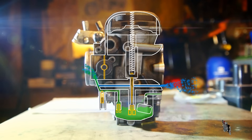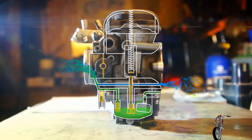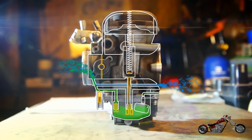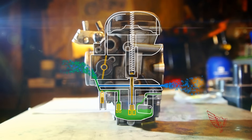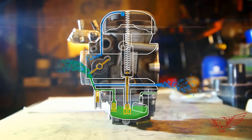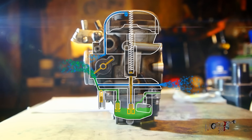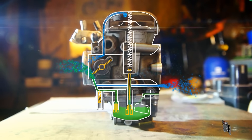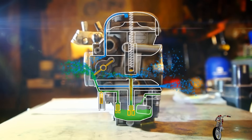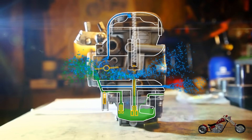Now how does it work? In idle condition the fuel is sucked out of the fuel bowl through the pilot jet and is mixed in with the air before going into the cylinder. The whole process is powered by the low pressure vacuum that the piston creates inside the cylinder. When we twist the throttle we directly affect the butterfly valve that opens up. The low pressure also starts to affect the top vacuum chamber — the diaphragm is suctioned up and with it the slide and the jet needle are raised. As the jet needle is raised, its tapered shape allows for more and more fuel to be suctioned through the main jet. By the same token, as the slide opens, more air is let through the carburetor, proportionally to the quantity of fuel.